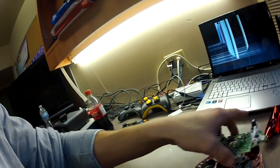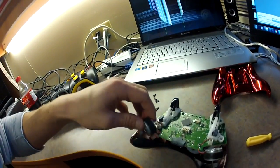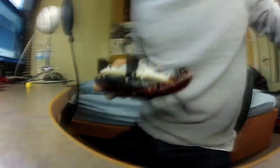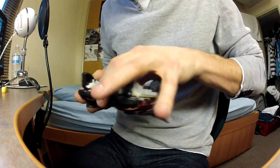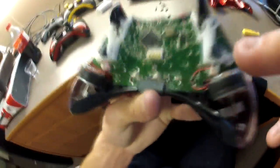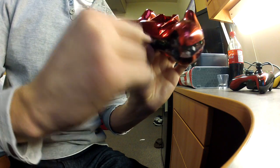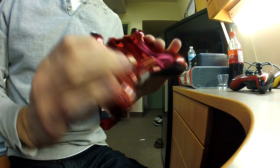The difficult part — always the hardest part — is putting this back in, and that's just with the joysticks. I'll do a joystick tutorial in just a minute. I'm gonna try to put this back in gently — not the easiest with one hand. Make sure the bumpers are all in hand. We popped it in — basically just put it in, make sure the vibrators are in place, then make sure every screw hole lines up. If it's snug in there, all you gotta do is place the shell back on, push these things in, it should snap down, then screw in your screws in all seven holes and you are good to go.